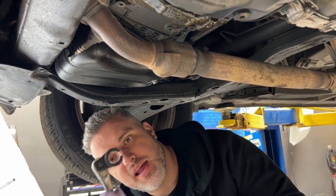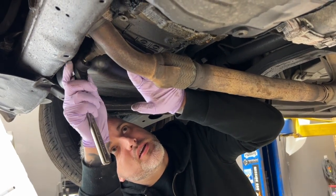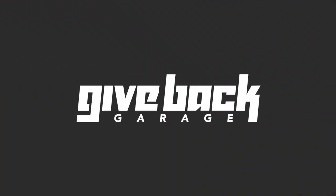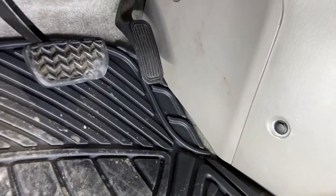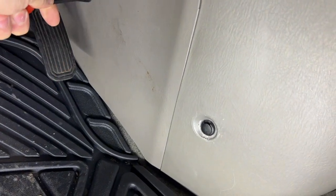We've got our special O2 sensor wrench — you just slide it on. We're also getting a trouble code P0037, bank 1 sensor 2, and that one is located underneath. Pop this little panel loose and you'll be able to see it right there.